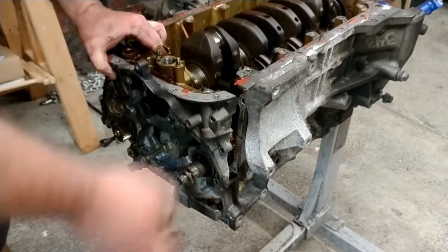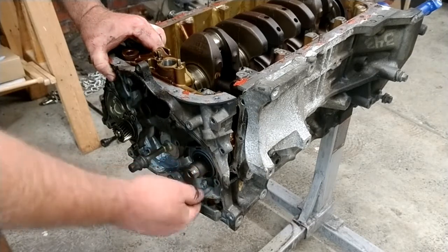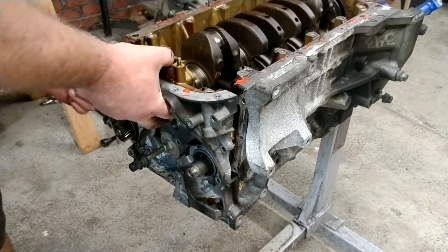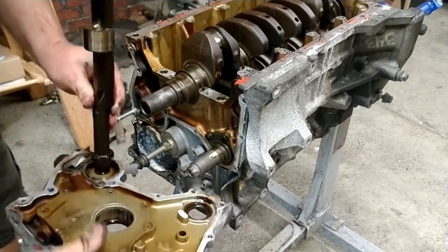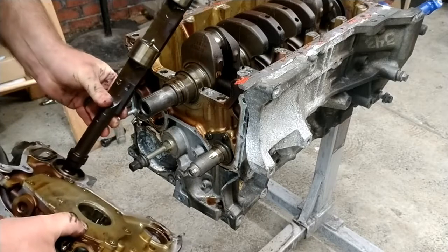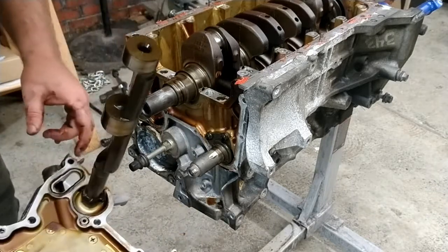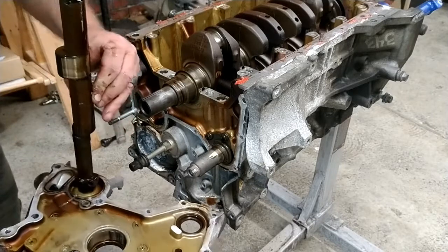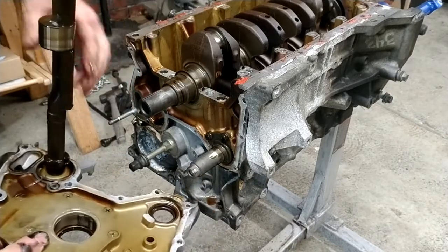Okay, this should come out now. It's bringing one of the dampers but not the other one with it, so I'm going to pull this bolt off and let this dampener stay where it's at. I can see it's got some additional bolts behind it, but this one looks like it's coming with the plate whether I want it to or not. There you go. This part here is the oil pump for the engine — it's just a weighted spinner. As I mentioned in the first video, I had a really bad oil leak in the front and thought maybe it was the front main seal. But after looking at where the oil was coming out, I'm thinking now it was probably the O-rings for this dampener. I certainly wouldn't want to tackle that while it was inside the car, so I'm still glad I pulled this out.